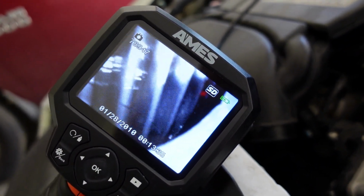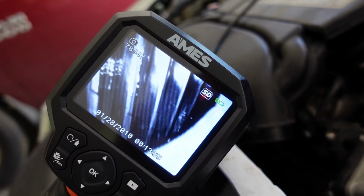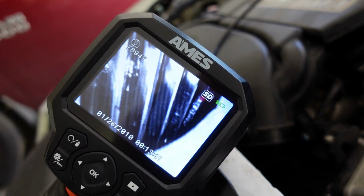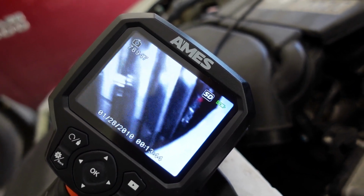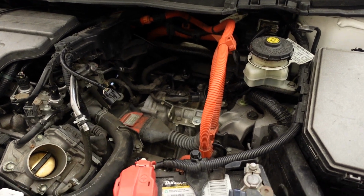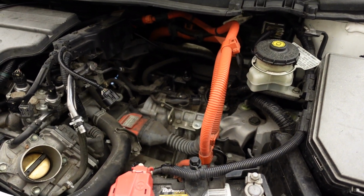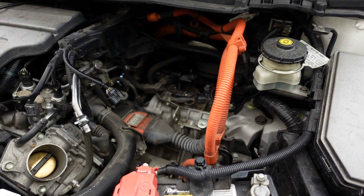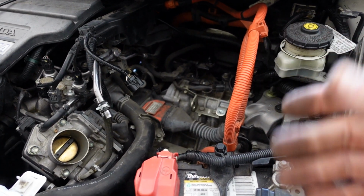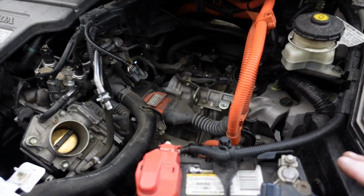Except for that, you can hear the balls. That sounds like bearing balls to me. You can see the lube. It's just looking perfect. But that would explain it. If we've got a bearing that's supposed to be locating this gear that has lost its race, and the balls are not where they're supposed to be, it's not maintaining the center, and that can allow this gear to move.